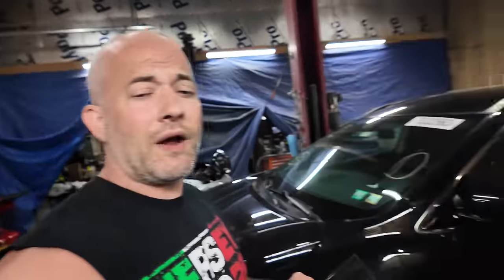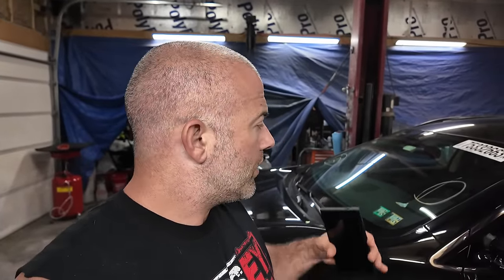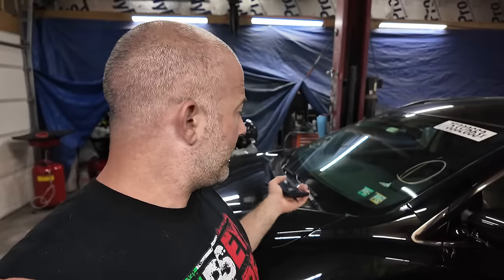Okay, once I did that, it was gone, but then it was giving me a key system error code because I deleted the memory in the, I don't know if it's in the TCM. I don't honestly know. Okay, we'll just put it that way. I don't know for sure. I just know I deleted something in there. So then when I'd put it in gear, it would shift hard. It would go clunk, and it would hit reverse and drive same way. That's because I deleted the parameters. And to relearn it, there's a QR code on top of the transmission.